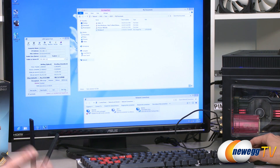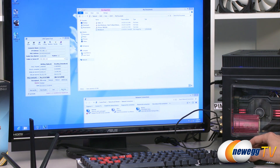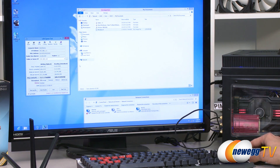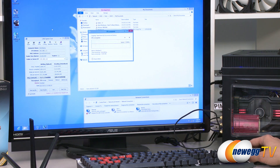This should theoretically be the same bandwidth available, but with less interference, so you should be getting maybe 30, 40, 50 percent quicker. Already here we see a pretty big jump — we're around 157 megabits writing, around 190 reading. So we saw a very big jump on the 5 gigahertz band. That really shows how impacted the 2.4 gigahertz band is around here in the office. Especially if you're in an apartment building or industrial area with lots of people and different routers — a very crowded, high-interference spectrum is going to hurt your speeds. Looking at the 4 gigabyte file on 5 gigahertz 802.11 N, we went from 9-10 megabytes a second up to around 17, so we've about halved the transfer time.